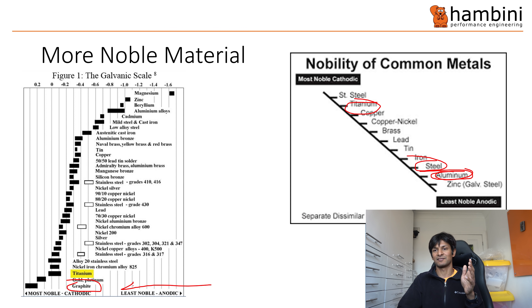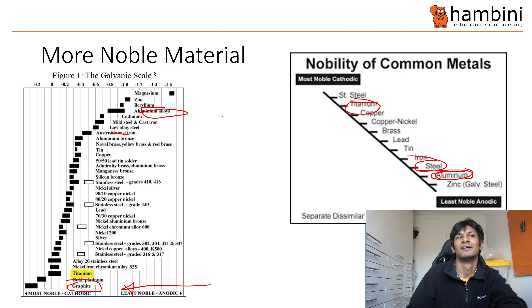Carbon fibre, which is graphite, is basically completely cathodic — about as far inert as you can get. And aluminium alloys are only about fourth on the nobility list, below magnesium. So a lot of bikes have carbon fibre and aluminium together — you are going to set up a battery and a galvanic cell as a result.